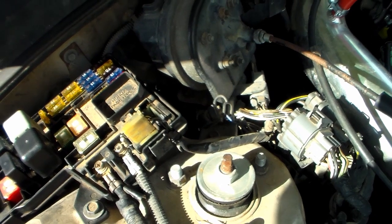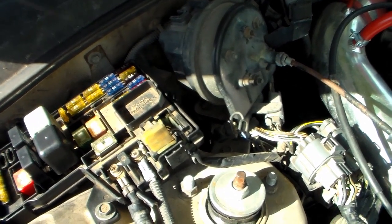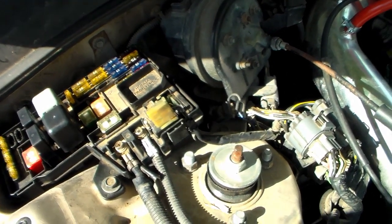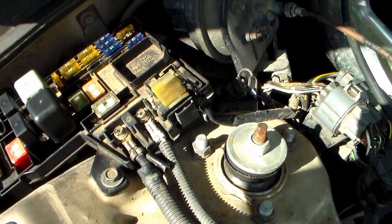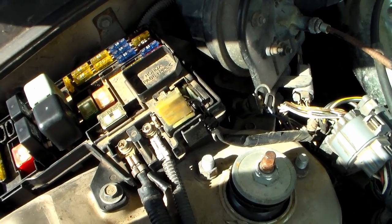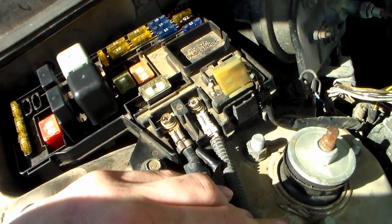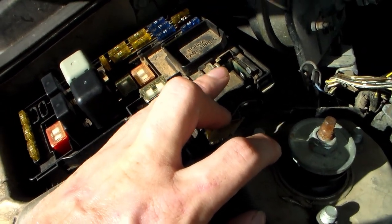What wound up happening was I was driving the car, the car shut off, had a check engine light and a flashing D4 transmission light — this is an automatic. I wound up pushing it down the road, got it into a parking lot, fortunately somebody ran up and helped me. We took multiple things out and checked. The main relay was very hot, the capacitor was exploded in the ECU, and this smelled like hot garbage.